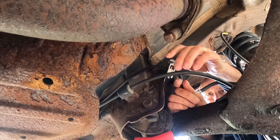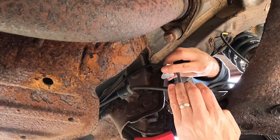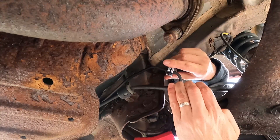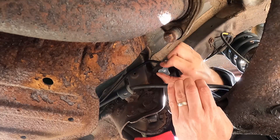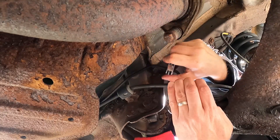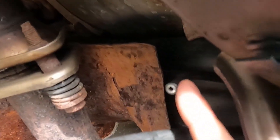I'm going to get my cutting tool positioned roughly where I want and tighten the thumb screw up just so it's barely snug. The emergency brake cable is in my way a little bit, but I should be able to spin this and tighten it as I go to cut the line. So we've got a nice clean cut on the line — now I'm ready to flare it.